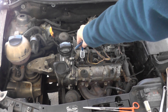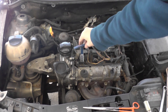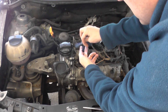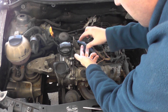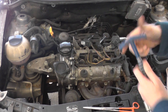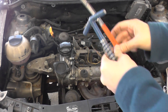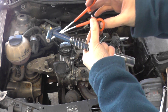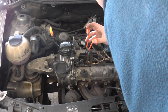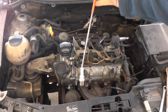Put your spark plug remover in there and twist it out. You need to give it about 10 turns to make the spark plug come loose. It's already loose but it won't free just yet. Once you've done that, you're still faced with the problem that the spark plug is still way in there, so use these long nose pliers to get it out.